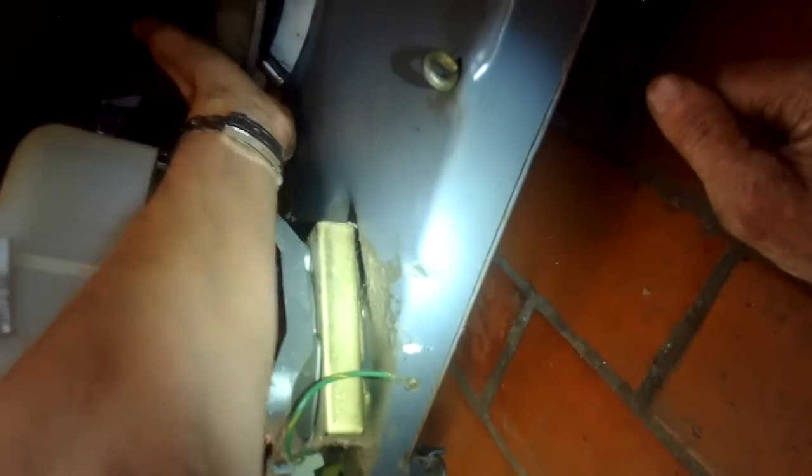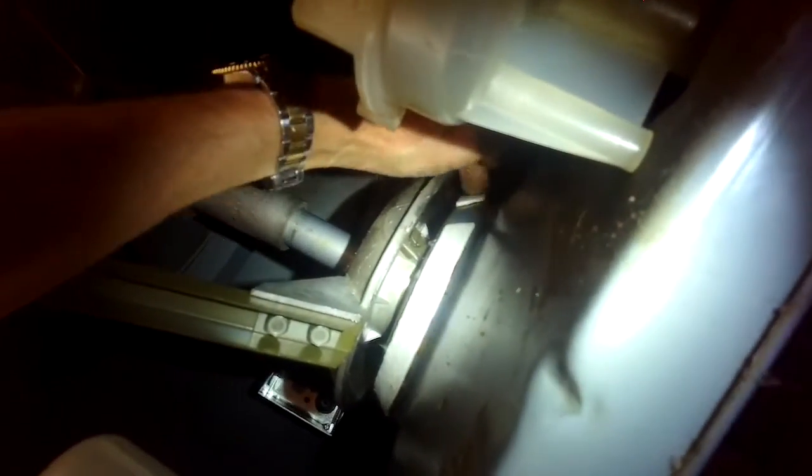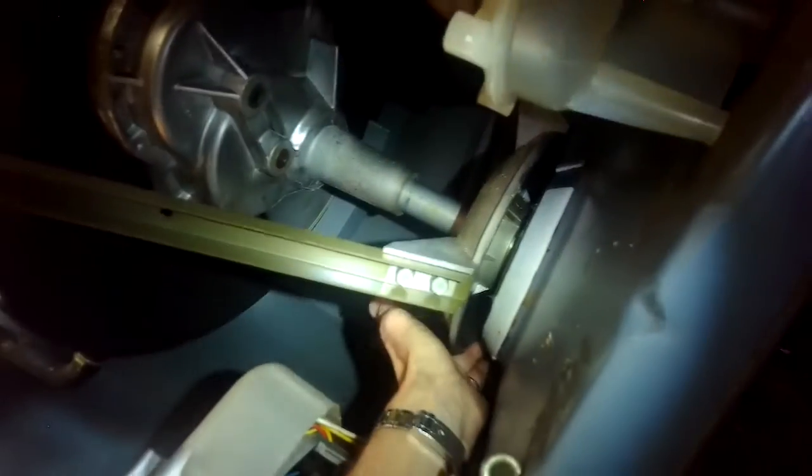There is another procedure too where you can remove the pulley on the bottom and the brake assembly, and then pull the whole tub off to give you a lot of room, but it takes longer. So I kind of like to do this one, where you just put it on a couple of 2x4s to create about 4 inches of area where you can work. So I'm now just pressing down on all 3 of them to make sure they're securely in position.